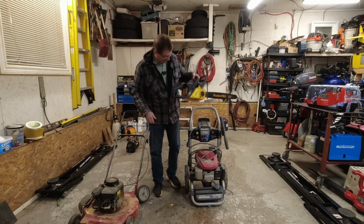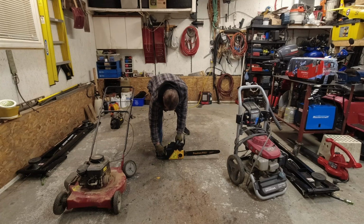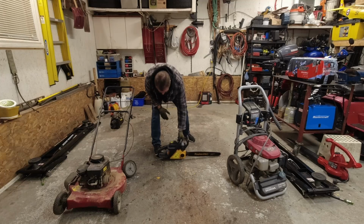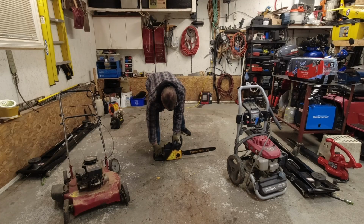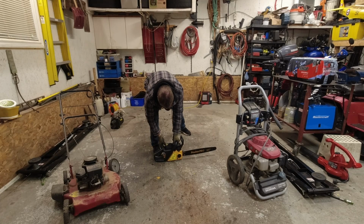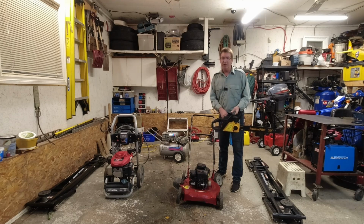Anyway, I'll show you what this sounds like. So, like I say, this one wasn't worth the video, but I'll show you. This was something somebody threw out, choke on. Uh, 150 psi on the compression, so it's actually a pretty good chainsaw.